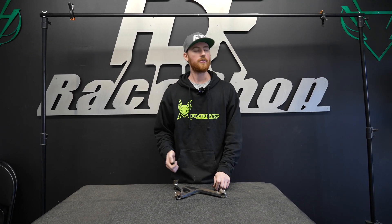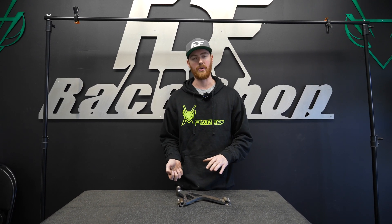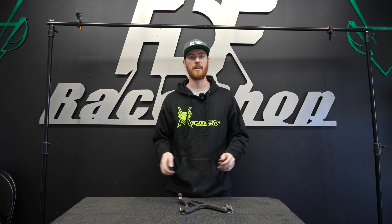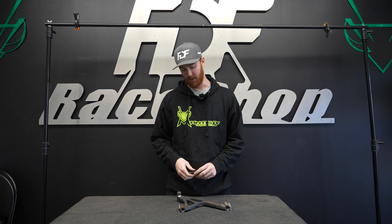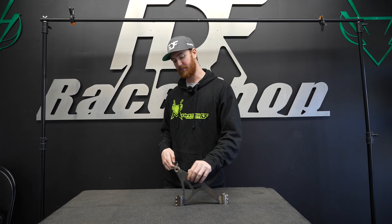Right after this video, a couple of days later, we're going to be installing these onto my C6, showing you the installation process and how easy it is to adjust and tune your alignment. The biggest thing on these Corvettes is that when you lower them they gain camber — and for drifting that's bad. We have a lot of camber wear on the tires and we're not using the full tire while drifting. We want to extend these arms a little bit and bring in the lower as much as possible to square up those wheels for good camber wear. These are going to be — and already have been — a big seller. This is just an in-depth video on how we go about coming up with these.